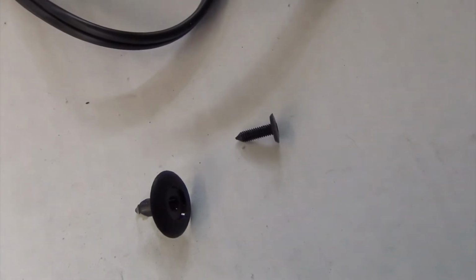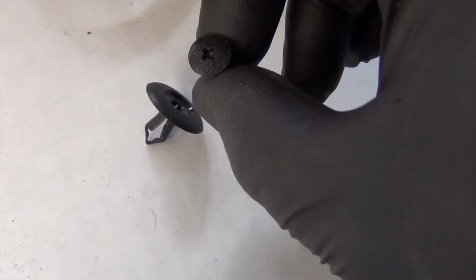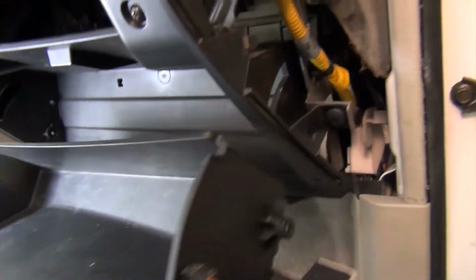But I'm going to use two hands for that. A little note on this side screw. It's a little plastic screw that goes into a little sleeve and expands out. So just be careful with this guy. Just gently, take your time. It is a very fine thread, so it will back out on its own. And then you can just pull the sleeve out as well. Okay, with the side screw out, you should be able to take the box out.